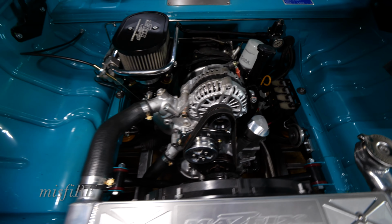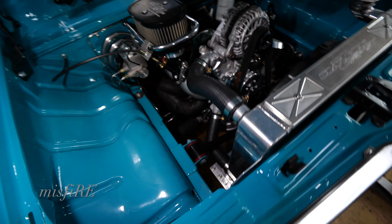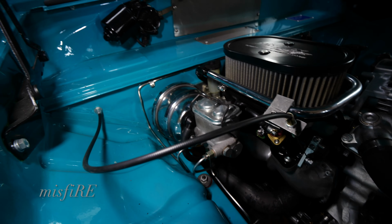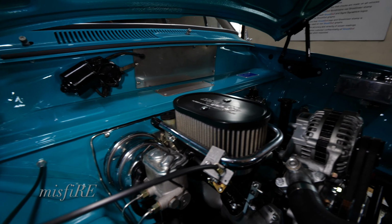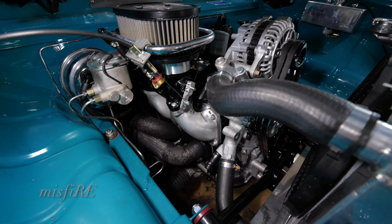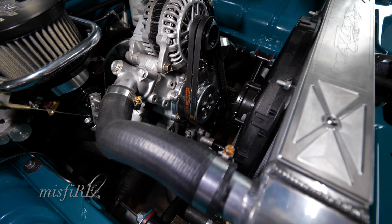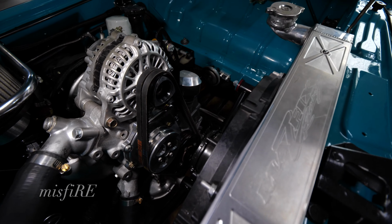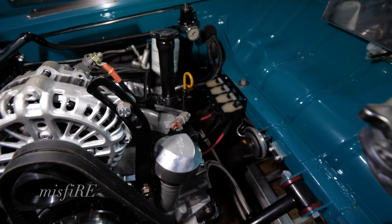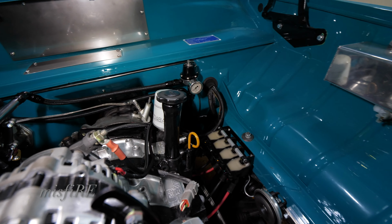We got a 13B engine, did a Bridgeport on it, rebuilt the motor, and went to work fitting it into the Torana. We rebuilt the engine, put injection perfection throttle bodies on it, four injectors. Now, what gearbox is it running? It's a Series 4 turbo gearbox. And the clutch setup? It's just a single plate, super heavy duty.